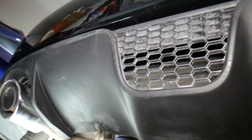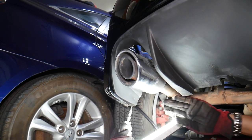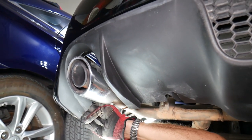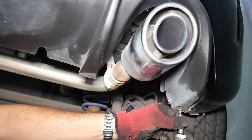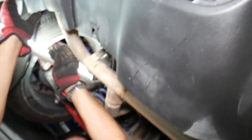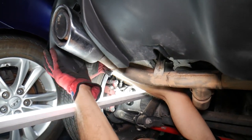Ours is missing one bolt on that side. We also have bolts with Torx — this one is Torx 15. In the corners there is one bolt on each corner, one on the left and one on the right side. Then it has just a few clips that we're going to release. At that point we need to inspect everything, and we're going to compress the clips from the inside and start pushing out.